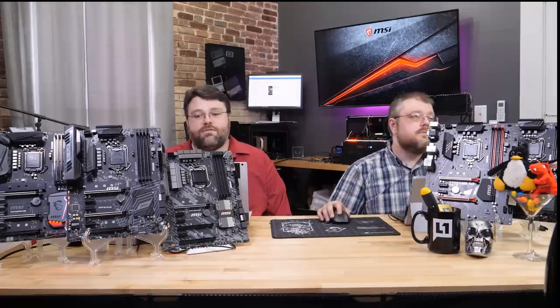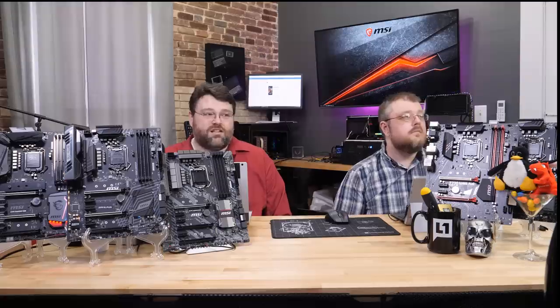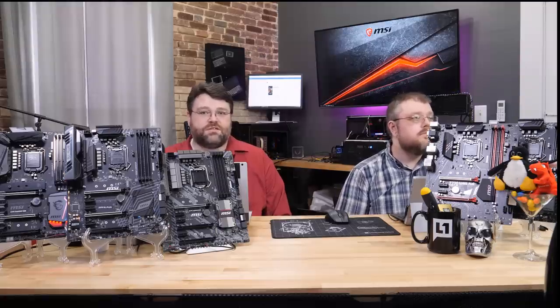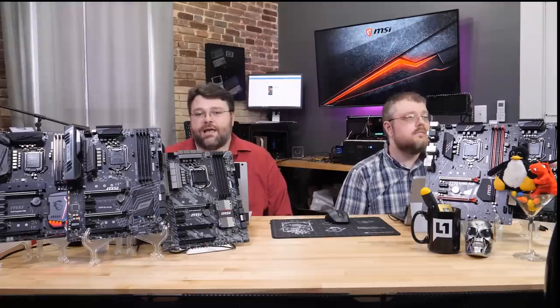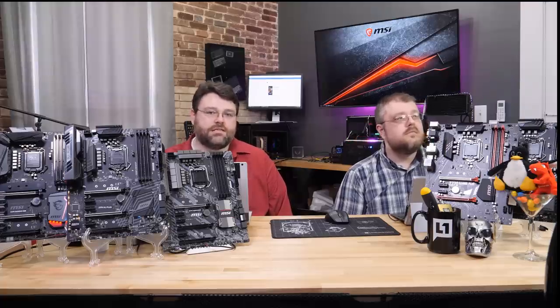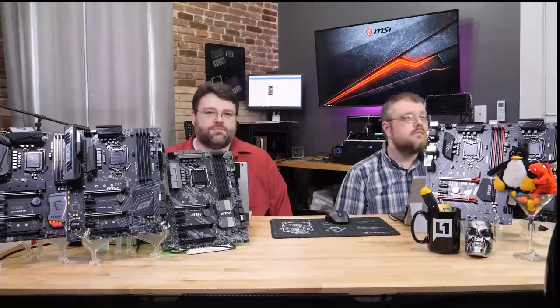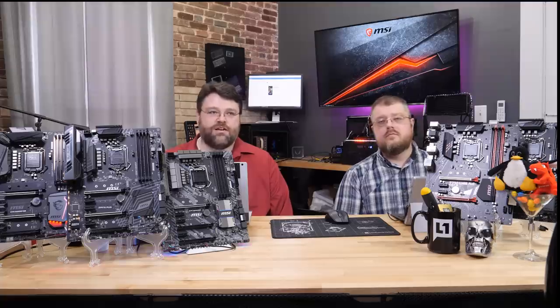Oh, and the RAM is up to DDR4 2666 stock, but a lot of these motherboards support DDR4 3600, DDR4 4000. And because you've got six cores to feed now on the i5 and the i7, we're finding in our benchmarks, which we'll get to, that the extra memory speed actually does help a bit, especially if we're talking about 1080p, 140 FPS type gaming.